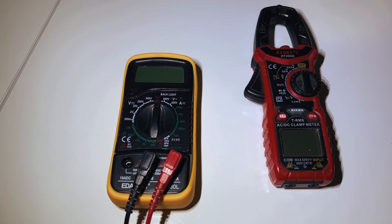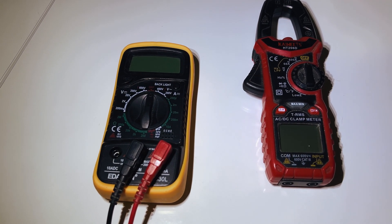In this particular case, the B2B was reporting a low voltage — pretty much 12 volts. When the engine is running, the starter battery should show a much higher voltage. In fact, when we checked the starter battery, it was showing 14 volts. So these were my two tools that I used to help diagnose the problem.